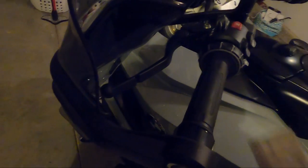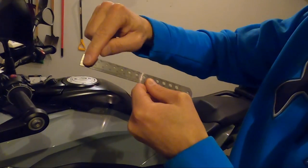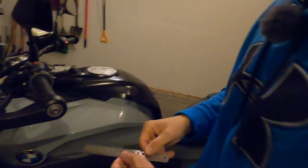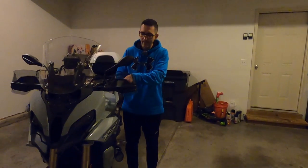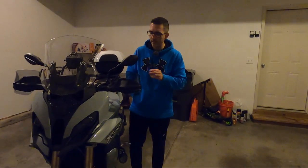All right, let's check this now — that's a lot better, I can already tell. I'm using a small ruler marked off in millimeters, measuring from the top of where my clutch sits, and checking how far it moves when I pull it. I'll include a picture from the manual in this video. That's about seven to eight millimeters, and I'm actually really comfortable where that's at. I prefer to err on the side of a little looser so I'm not running it too tight and causing clutch slip.